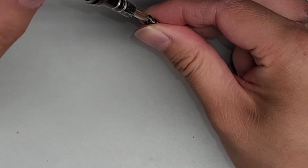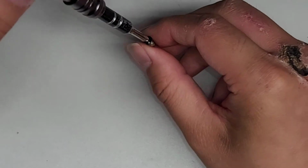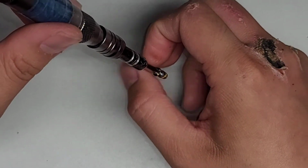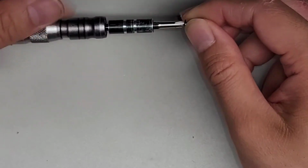It's kind of as if I was just holding this tight and you open and undo these screws. But again, when the hinge comes loose, then it no longer becomes a smooth motion like this. Then it becomes a gap, and then it pries it out. And what happens is the plastic here isn't strong enough to handle that, and the plastic cracks. Once the plastic cracks, this whole brass piece just comes out of there and those hinges break.